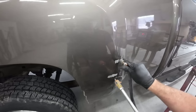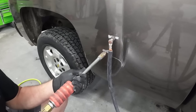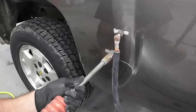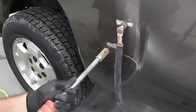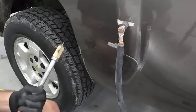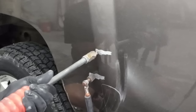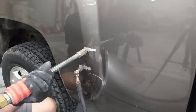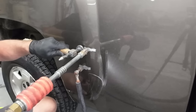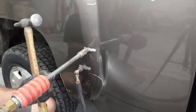I'll just ground this right here. Find the low area. I'm probably just going to pull on this, so we'll weld it and I'll just pull it a little bit - it's really not going to take much. In some of these areas I'll be pulling the center of the dent and then I'll tap down with the hammer a little bit of a crown that's around that dent. When a dent's created it pushes in the center and it raises the metal around that.